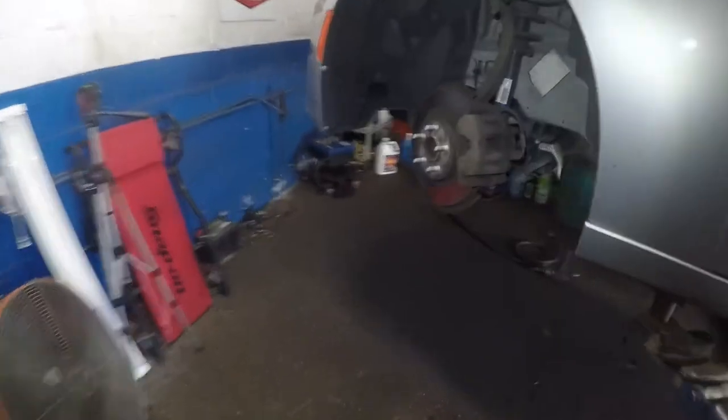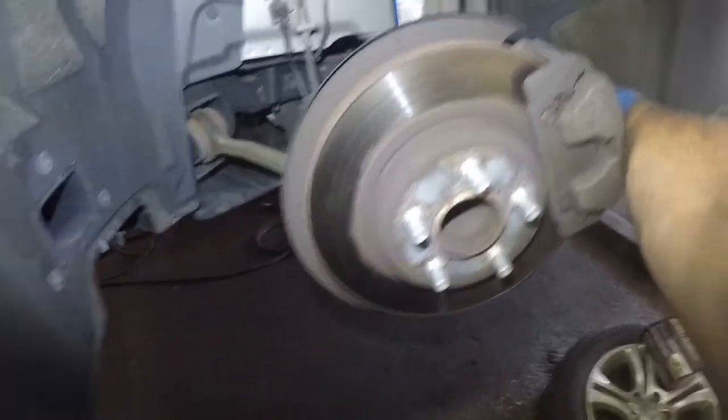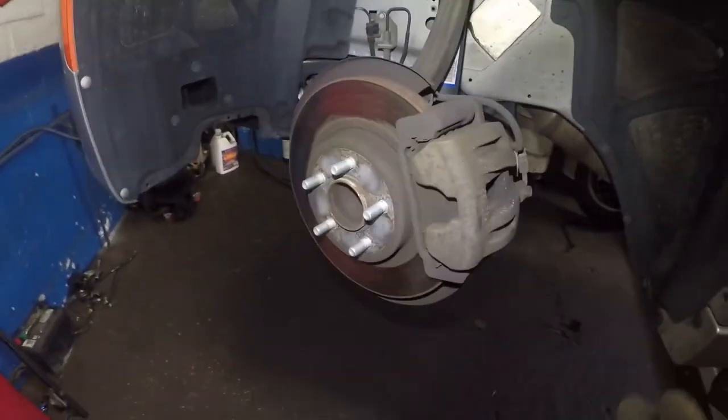What we're going to do is turn your steering this way and pull the caliper. We're going to remove this number 13 bolt right here for the caliper bracket, and this one. Also, you're going to need to remove this number 10 right here for this bracket, because it's not going to give you enough clearance. These are thread-locked in — very difficult to get out.